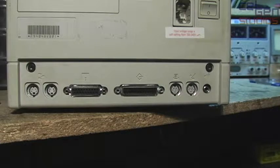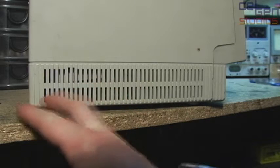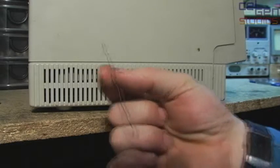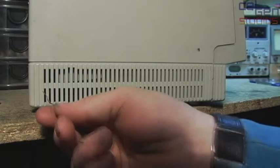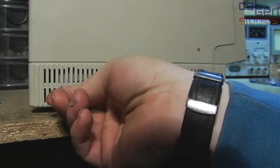The programmer's switch, however, is a little bit more difficult. It's an option usually included with the Macintosh SE — a little tiny switch that connects right over here and just kind of clips on. Some people never even bother to install it and it typically gets lost, but you can still reach the buttons using a straightened paper clip. All you have to do to find the interrupt button, which we're going to use in this case, is poke through the first, second, third, fourth, fifth hole. The button is right there for you to push.